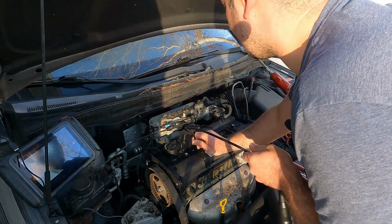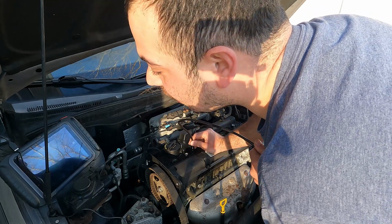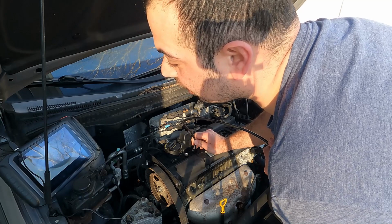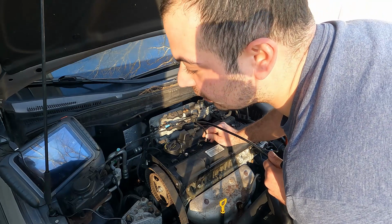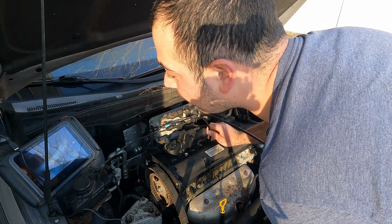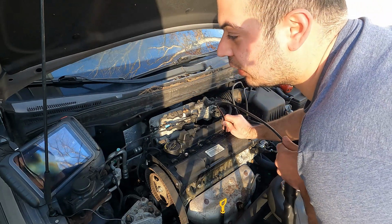That piston's up at the top, so that means number three is going to be up at the top too. I could try to rotate the engine a little bit, but like I said, if there were contact, you'd see the shiny spot at the edge of the piston, and I'm not seeing that. So let's go ahead, look down number three. Again, this is going to be very similar in position. And then let's look down number four.